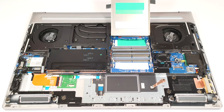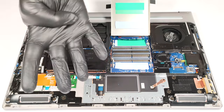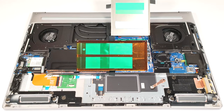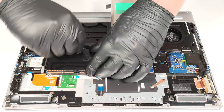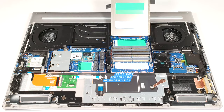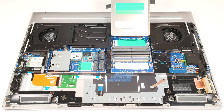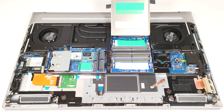We can spot another duo of pads on the motherboard for the bottom-positioned RAM sticks. Below the second metal shroud, which also has two pads for cooling the top-positioned NVMEs, you'll find the four M.2 slots compatible with 2280 Gen 4 SSDs or self-encrypted SED Opal 2 units. They are additionally secured by retention covers; you have to undo two Phillips head screws before swinging up each cover.